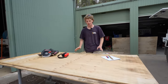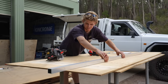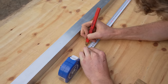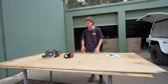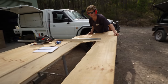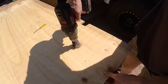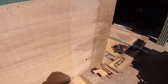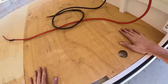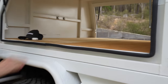Before I fix down my aluminium, I'm first going to be cutting out my floor sheets. I'm using 12mm ply — we've got a bunch of this at home and it's really easy to work with. Being 12mm, it's sort of the lightest you can get while still being structural. So I'm just going to zip out a couple of rectangles — they're pretty basic shapes — and then we can fit them on the floor. Floor sheets are in and we've got a nice flush finish. That's what we want.